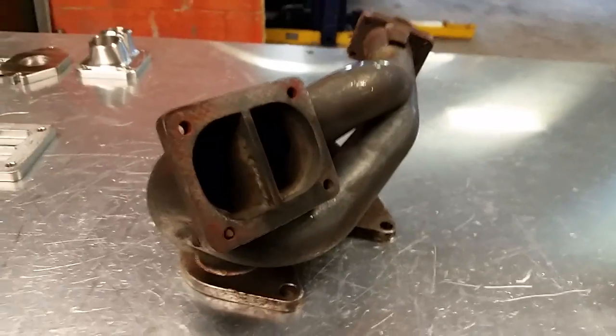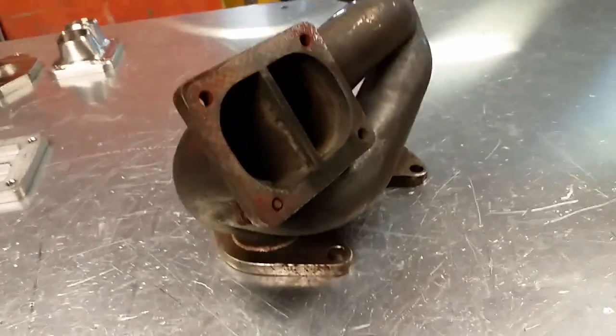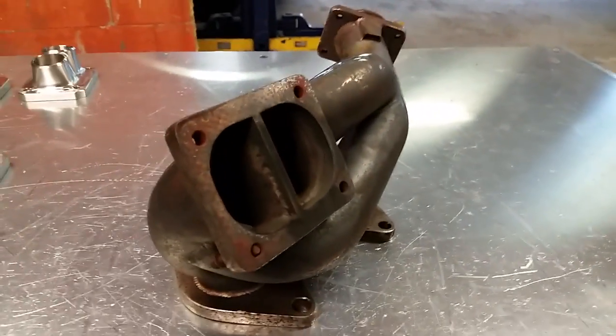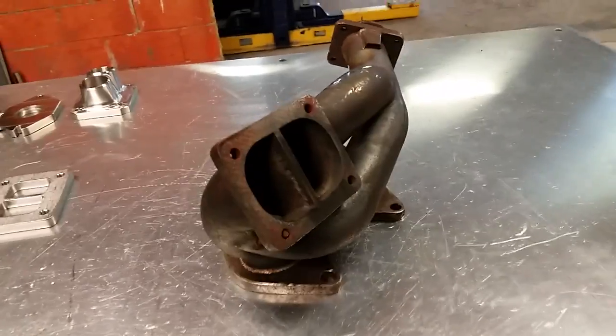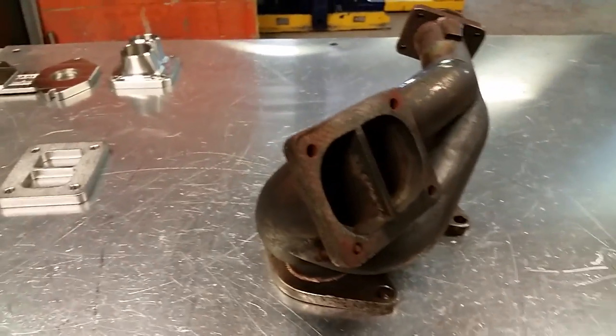this is a big one. You can call the rest of this nitpicking, but you can't call this nitpicking at all. This is where people have major boost control issues on this turbo. And it might be fine for their smaller turbo with modest boosts, but the second you get something bigger and you try to make max power, or you try to make really low power or something like that, you have boost control issues. And that's why everybody's like, junky manifold boost creep. And that is like the major disadvantage. This is what kills engines. This is what makes a car.